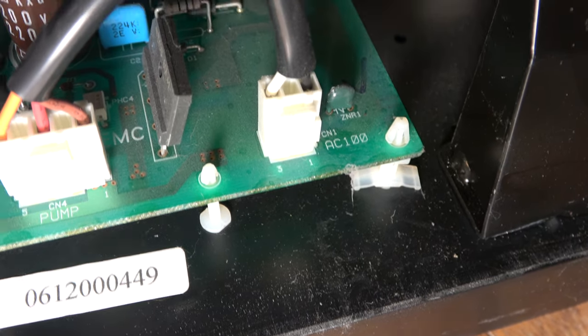And we also have this regulator. It looks like the transistor feeds the 5 volt regulator, and the transistor itself is fed from the 15 volt regulator. Okay. We have some rectifiers and smoothing capacitors. So we have, it looks like, a winding here and a winding here for the transformer. One goes to this rectifier and one goes to this one. This then goes to smoothing capacitors, which are 25 volts, or one smoothing capacitor at 25 volts. And then links straight to some outputs. So that's unregulated. So our interesting one is likely to be this there. Yep, that's earth. The rectifier goes to capacitors, yes.